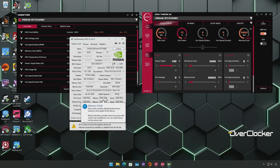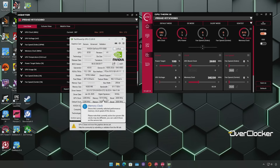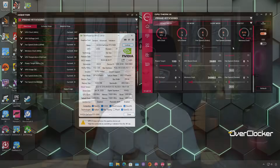That's not the case with the RTX 5080. The maximum GDDR7 clock seems to be internally limited, likely by some logic within the GPU or driver. No matter what you set in the software, 36 Gbps is the highest it will go — that's 6 Gbps more than stock. Keep in mind that this card actually uses 32 Gbps memory even though it runs at 30 Gbps by default, so effectively you're looking at about a 12.5% boost over the DRAM IC's rated speed.